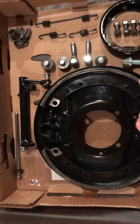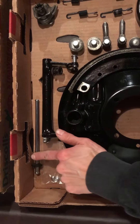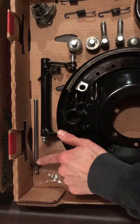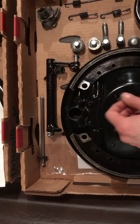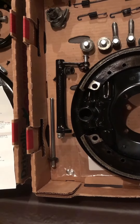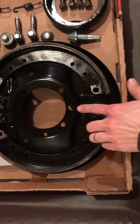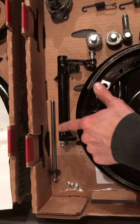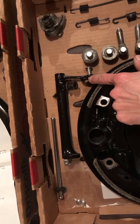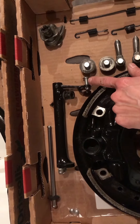Here is our brake pin with the felt — don't forget the felt. The felt actually goes up underneath the kingpin and protects and keeps stuff from getting in down here where the wedge goes. We've got our brake arm assembly, and make sure you check these with a good pin to make sure it's not loose.